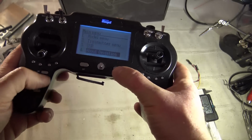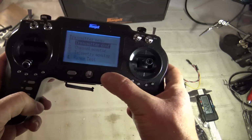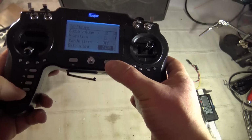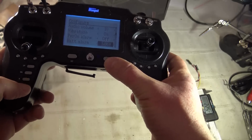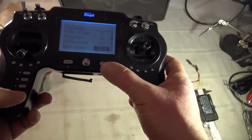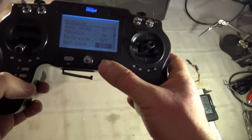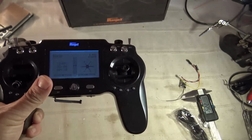to adapt. So how to do it: you have to go to the transmitter menu, go to the transmitter configuration and go down until you find the battery alarm, and you have to change the value using the left button, and set it to about 5 volts, for example. When you are done, the transmitter won't ring anymore, or you can even go a little bit lower, something like this. Okay, it's done, you can exit now. No more low voltage on your screen.